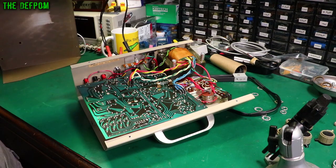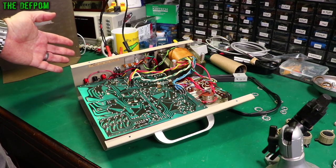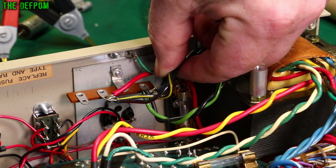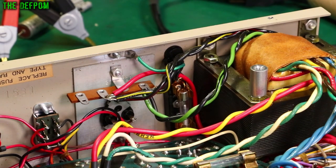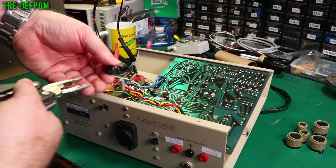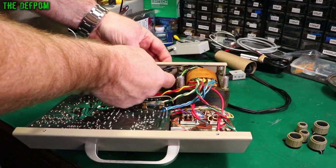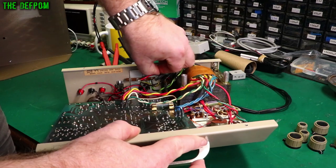We'll put it back together. Obviously I've got to replace the power cord and rewire this for 240 volts as well. Now as I mentioned before when pulling this thing apart, here's the earth wire — the original earth wire has been wrapped around but not soldered. Someone missed it. It's been dangerous for 40 years. I just pulled the gland out by squeezing it with pliers to clamp it down and pull it out of the hole. I've got to take those three mains wires off.